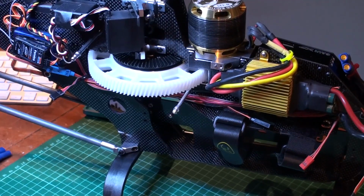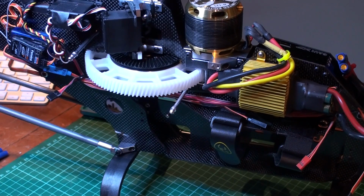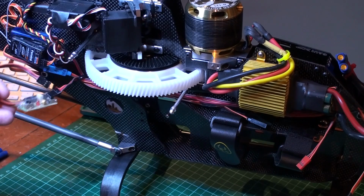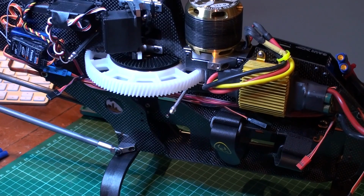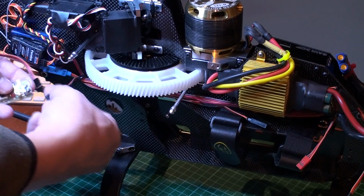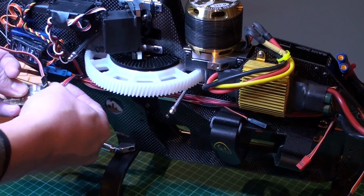What you want to do is to connect. Here is a throttle cable out of the speed controller. I'm gonna connect this IR receiver in between here, going into the receiver here. You can see on this one it says brown, and that's where we want the brown on the cable, so you get that correctly.